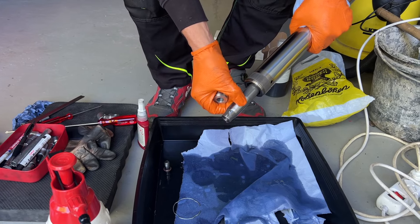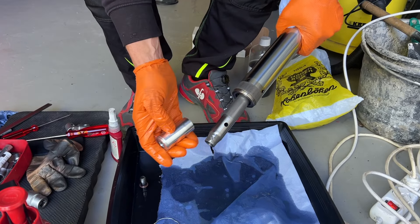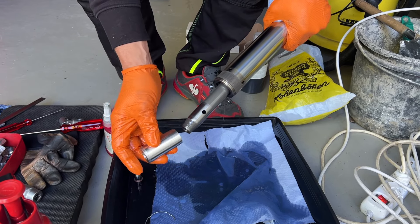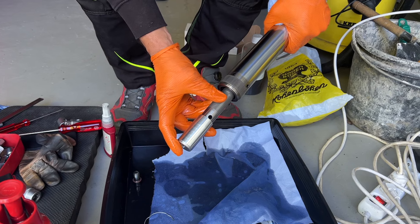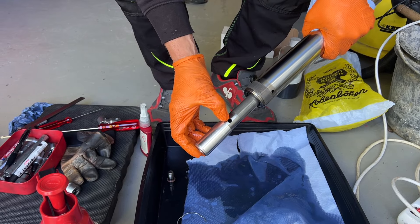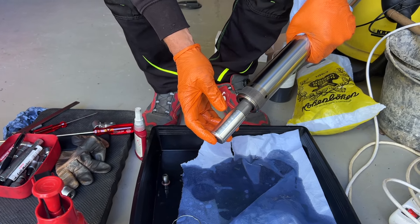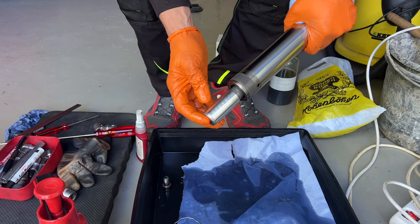So how is this working? The damping tube with the top-out spring is inside here, and the oil lock is down at the fork slider. The oil stop is blocking those oil passages, and that's what led to the problem — we couldn't bleed the fork and it was feeling completely wrong.